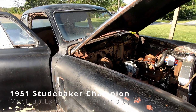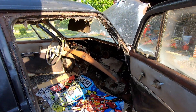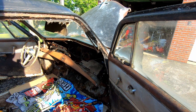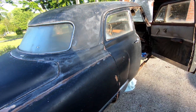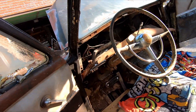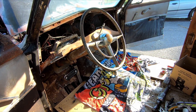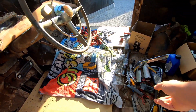Back on the Studebaker this morning. Yesterday I came out and pulled the dash out, at least 95% of the way. My plan is to just replace all the wiring in the car. I started poking around yesterday testing for voltages and voltage drop at various places, getting all kinds of crazy numbers - literally the entire range from zero volts up to 6.3. There's just so much voltage drop. I brought my good Snap-on meter home so it wasn't my little cheapo meter.